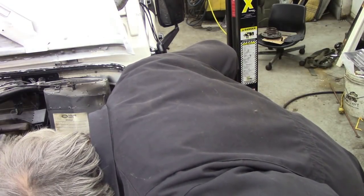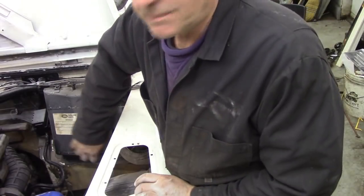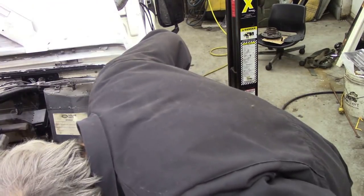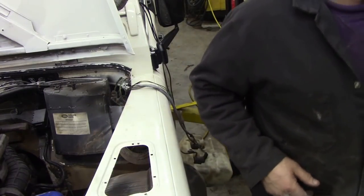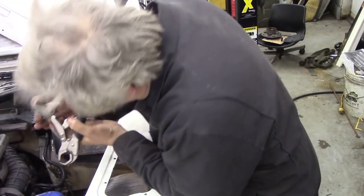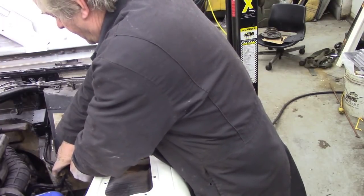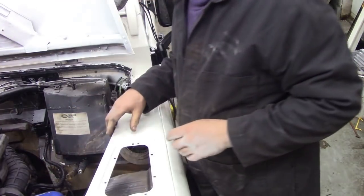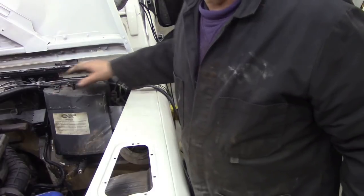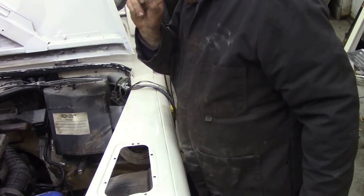Yeah, we've got to take the heater out of this. Two bolts at the top here and two little tiny nuts under here. I don't know why they couldn't do them captive. I think what I'll do is I'll get some vice grips, mole grips or these type of grips, onto the nuts underneath, under here, like that. And we'll try and take them off from the inside, and we'll try not to disturb the coolant, because there's two pop rivets here and there's two at the back that we can't get to. Let's see how we come on with that.